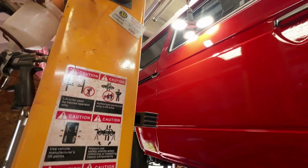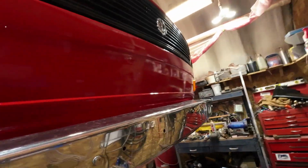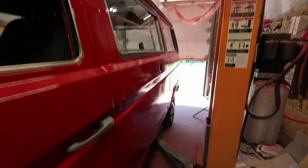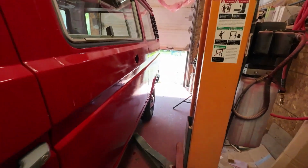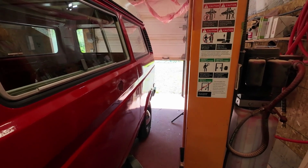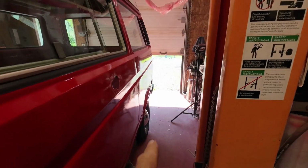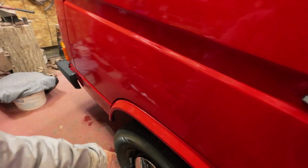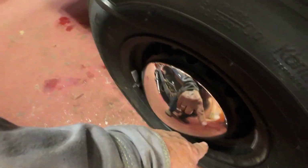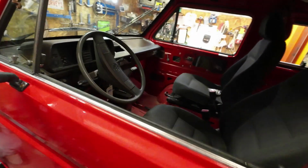Okay, so down it comes in a second here, and then we'll work on getting the wheels aligned. I don't know if any of you have seen me do this wheel alignment stuff before, but sometimes the camera just quits because it thinks I've told it to quit. Anyhow, I use a fishing line. I put a post back there and a post up here and a fishing line, then you measure from right here on the wheel and right here on the wheel, and toe in is about half a millimeter, give or take a bit.